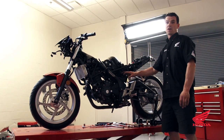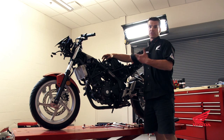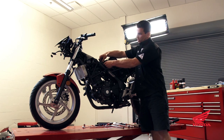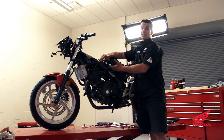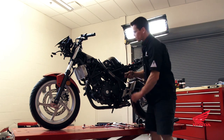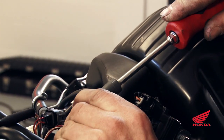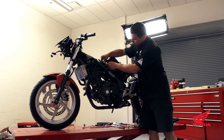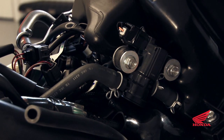Now that the ground is torqued on, we have to plug the PAIR valve air line, which introduces fresh air into the exhaust system — this will no longer be used with the DynoJet controller. Remove the air line. DynoJet says to just plug it; the easiest way is to get a 10mm bolt, cut a piece out of it, insert it into the air line, push it in a little bit — that blocks off the hose — then reinstall it on the valve and put your clamp back on. That way we've blocked the air movement in the hose.